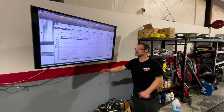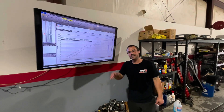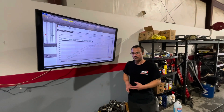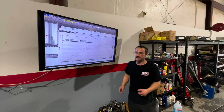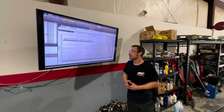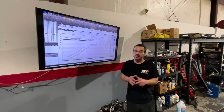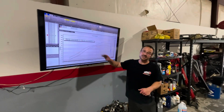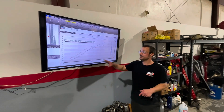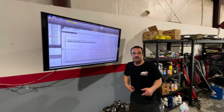Prototype 7 Series — here are your results. This is realistic for you to see this or higher with basically the 2,000cc injectors, an XDI pump from RV6, RV6 R400 intercooler, some TR2 cams, and a ported head — absolutely all day. You might even be able to, if it's cool enough out with just TR2 cams, make pretty similar power. And for a drop-in turbo, this kind of power is really kind of unheard of. I don't think I've ever seen this kind of power in a drop-in platform.